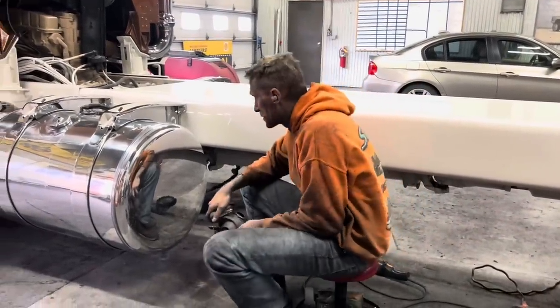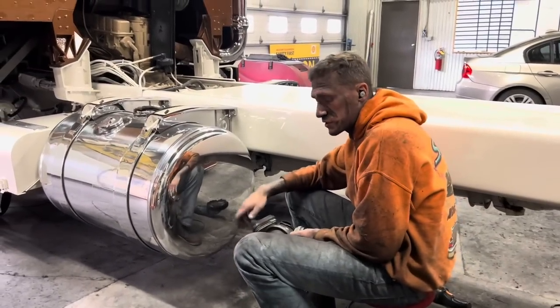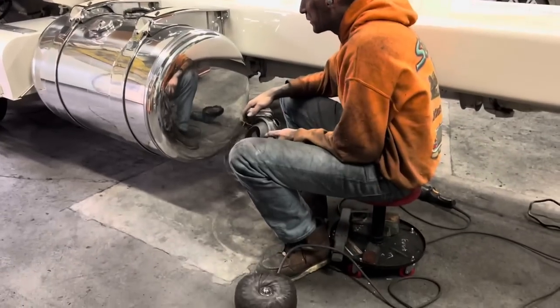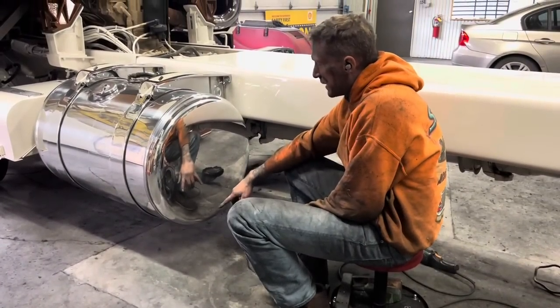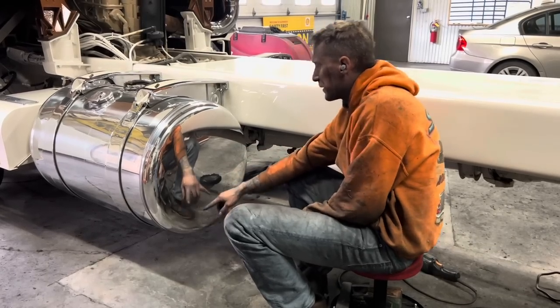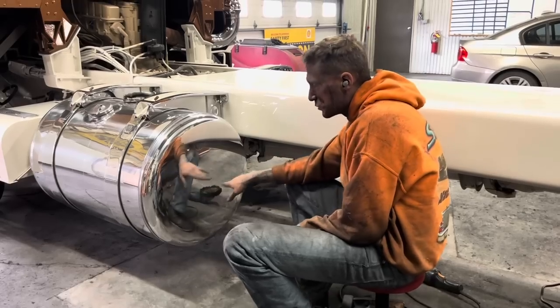So it's literally as simple as that. As you saw, same thing with the white and green. The green I loaded up a little more just because at 1400, the buff doesn't like to melt that rouge down real easy to get it loaded up. But once I had it loaded, I was just waiting for it to change that green color. And I went from bottom all the way to top so that I don't have any transition lines. There's no excess rouge in the middle.